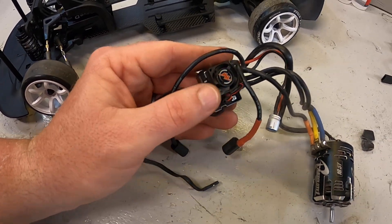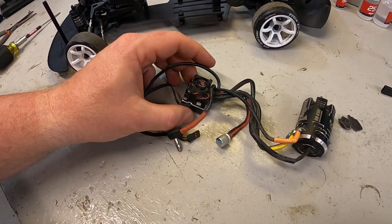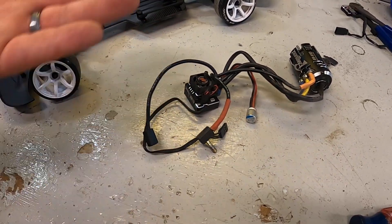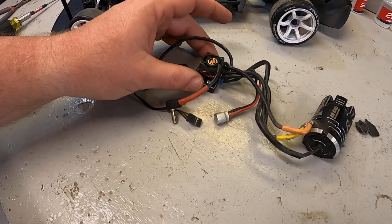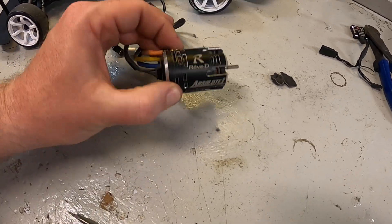This is a Hobbywing XR10 stock spec — 2S capable, 80 amp. This is not the XD10, which is also a really good choice but at a much higher cost. So this one is lower cost, a really good mid-range ESC for drifting, and I've used it for years with really good luck. The motor that I'm going to go with is my RevD 10.5 turn motor. You do not need to spend anywhere near this amount on motor and ESC depending on how and where you plan to use it. You can get away with a much cheaper Hobbywing like the 60 amp sensored ESC — the 10BL60 or the 10BL120. Both of those are very good for drifting, but they just don't have turbo and boost. It still gets you up and running for a fraction of the cost of that XR10 ESC.